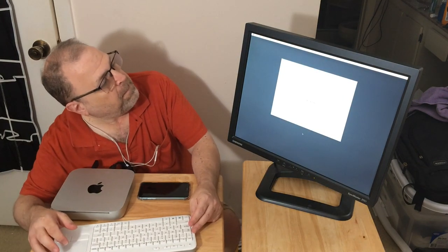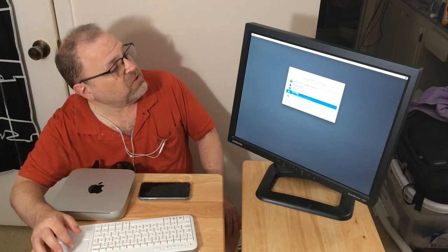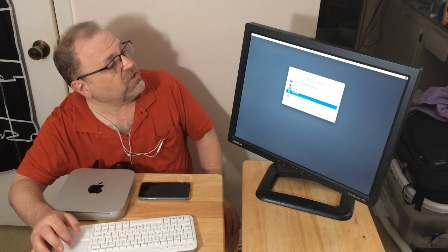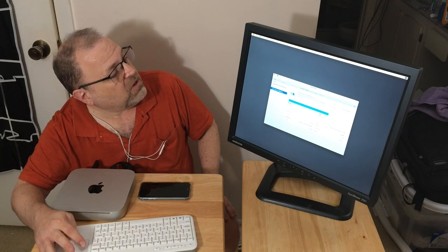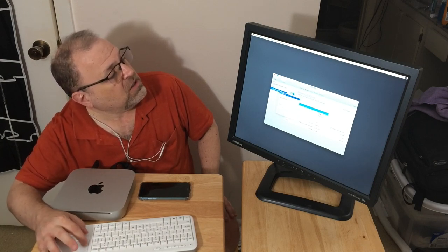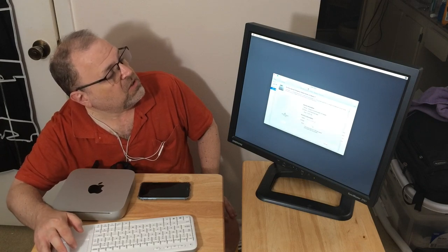It's difficult. So this is the modified Catalina installer. It's the standard Catalina installer, except this post-install has been added. And that's only if the computer requires it after, because it's also patched the installation routine to install any patches necessary for this particular model to go in place. So what I need to do first is format the drive. This is Utilities, Continue. Gee, I hope you can see this, but I'm not getting back up there again. I'm sitting on a milk crate, towel on it, on the floor here, and we are going to take this drive and partition it. No, that's the wrong one.